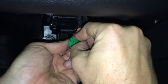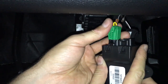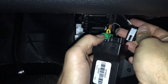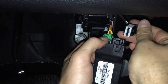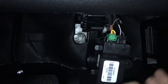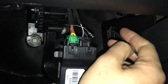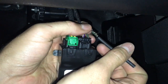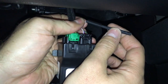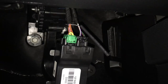I created a jump wire — simply took the insulation off, then spun it in my hand to make sure all the wires were tight. Jumped those two wires so now it has a constant 12 volt connection no matter what driving scenario you're in. Then put the wire connectors back into the module. To cover up the removed wire, since it will still have 12 volts running to it at five miles an hour or less, I took a piece of heat shrink and slid it over so it didn't rub against anything under the dash or cause a short.